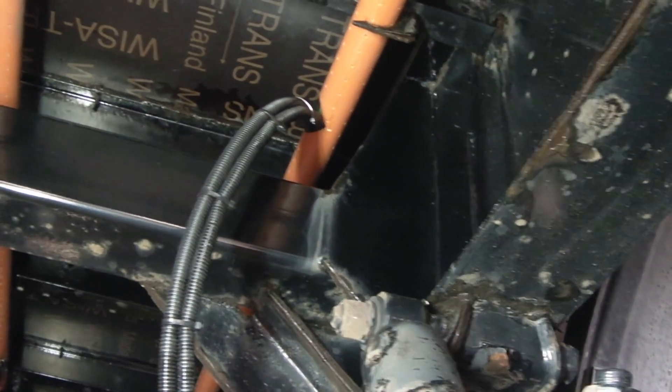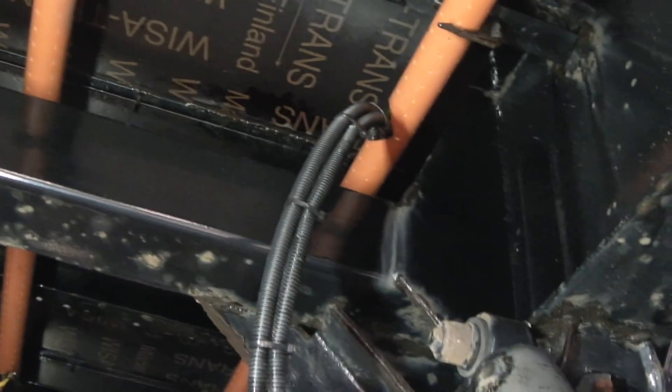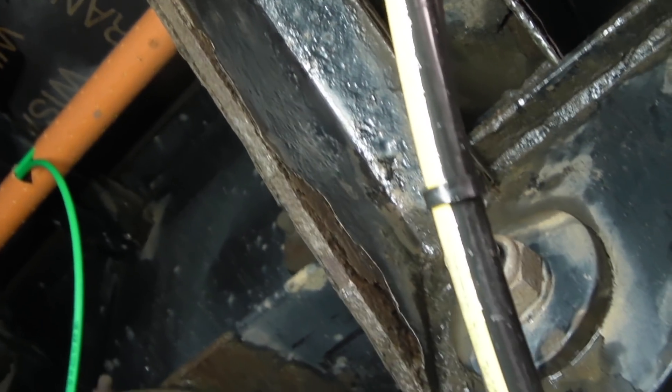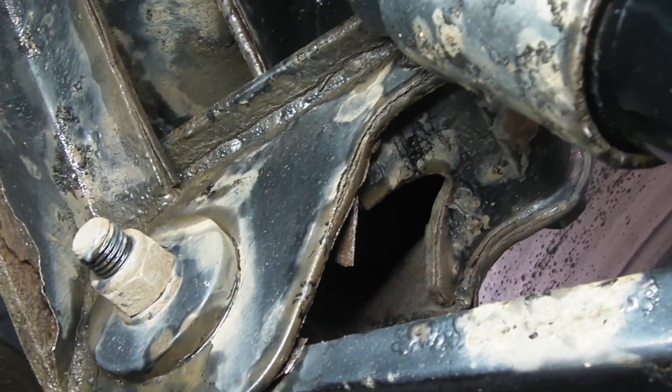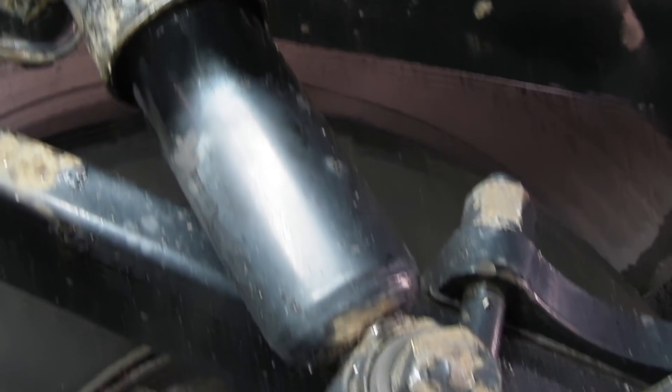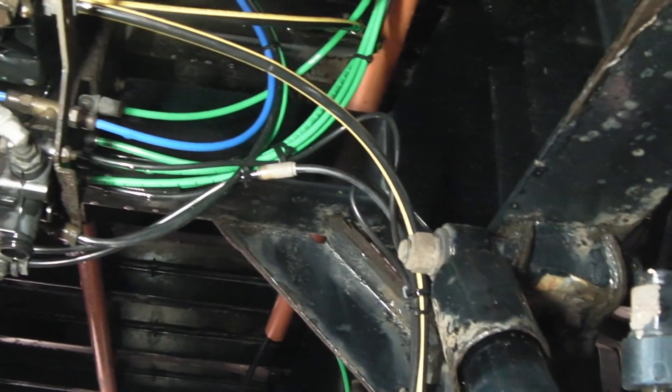Just as I was saying with the Defender chassis, on the edges it seems to be corroding. You can see where the paint has lifted off on the bracketry here. This is a spring hanger as well — on the edges the paint has gone and it's lifting off. As for the bolts, we tap these bolts to check if they're tight, so we've chipped the paint off and the paint's been damaged there. Again, edging here — this wouldn't have been touched by anything at all. We only tap the bolts.